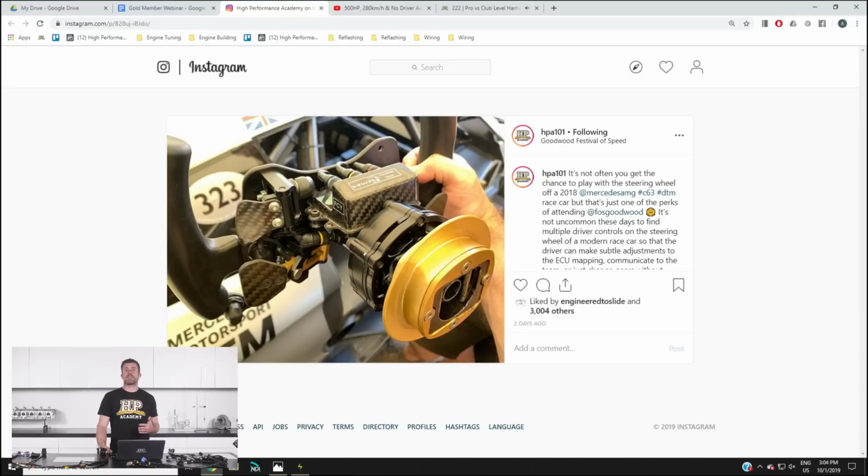Now, if you are considering jumping out and purchasing one of these pretty expensive Cantech hubs, I just mention though that they are still really designed primarily for purpose-built race cars, where you're going to have a limited amount of steering lock as well, because obviously even at the chassis side, you've still got to get your wiring out of that steering column. So if you've got a traditional factory style road car where you might have 3 turns lock to lock, you're still going to end up wrapping up the end of that cord at the column end.